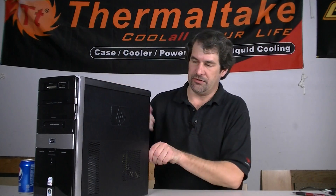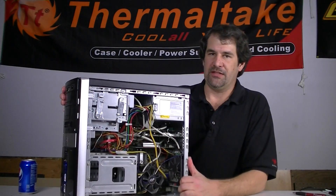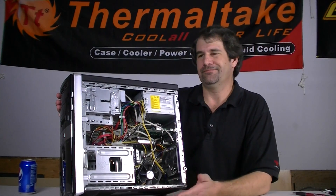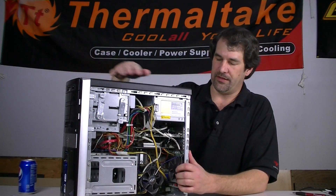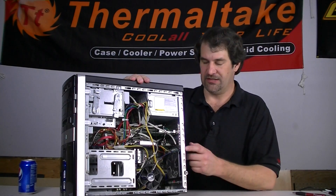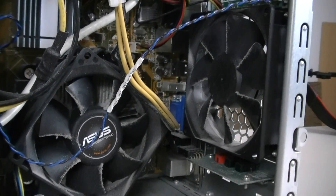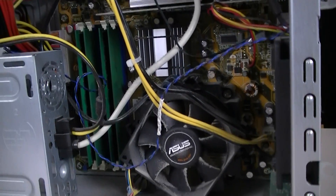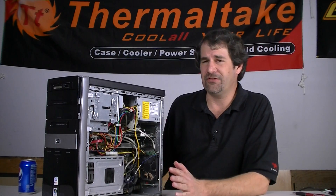Obviously we'll be taking the side panel off and showing you inside. As with a lot of OEM PCs of this era, including the HPs, it's going to be a micro ATX motherboard. It has a lot of media PC features like some media docks, a card reader up front, a video capture card for your television, and an HDMI and S-video video card. It's very low profile, obviously been used, and it's a bit dusty. Dual channel memory came standard on the Core 2 Quad of this generation, and right now it has all the memory slots populated, but that's all going to go away really soon.